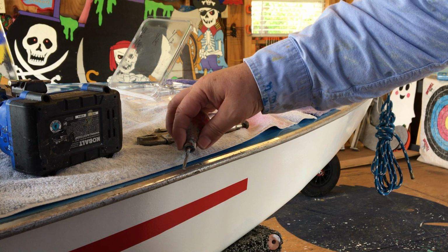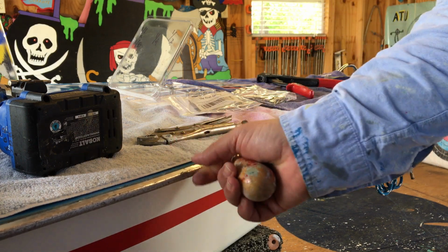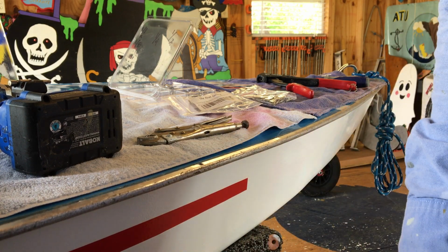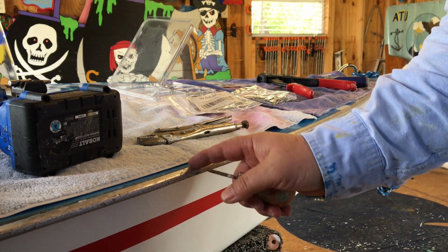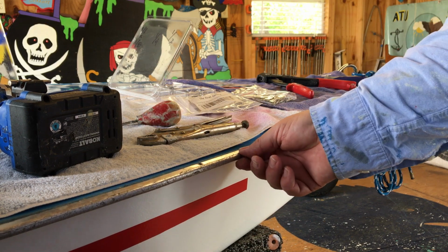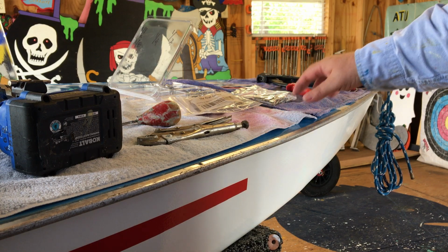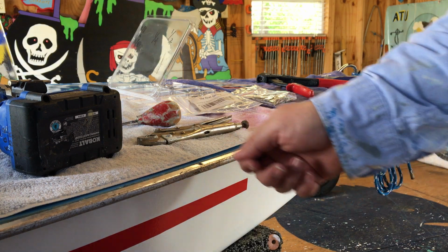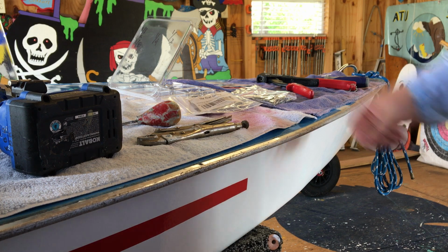And we found today that there was some kind of gunk on this inside channel that was keeping the trim from going all the way on, way back to when it was on factory, because this is the first time this trim's, actually that's not true, this is at least the second time this trim has been taken off before us, and I'll show you how we figured that out in a little bit too. So we've got the rivets, we'll talk about sizes in a minute. Got the rivet gun, and then we have a little ceramic file to take down any leftover bits of rivet that may be on there. So we'll get started now.